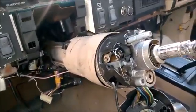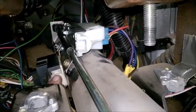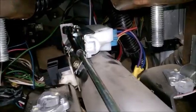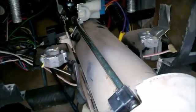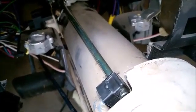Hopefully there's enough light where you can see this — just putting things back together. This is the bright and dim switch. This has something to do with — I'm actually not quite sure what this does — but it prevents you from starting the car properly. I noticed I had to have it all the way up, and I think it's for the neutral safety, or showing that it's in park maybe.